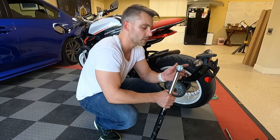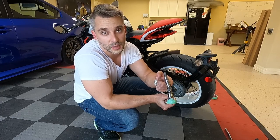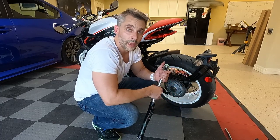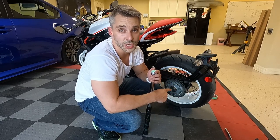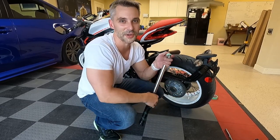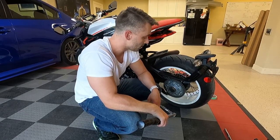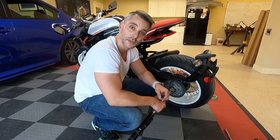A couple of final tips: you're going to want a knuckle joint when you torque these things down. Make sure you get that tape on there or you'll end up scarring that wheel up. And one last tidbit — when you're working around your chain, wear your dirtiest clothes, not your Sunday best. But we got her done. Remember you've got to have the bike vertical when you get the chain tensioned, and we're ready to let it rip — see you guys on the streets.